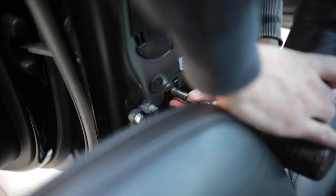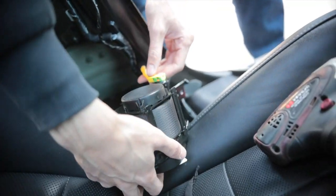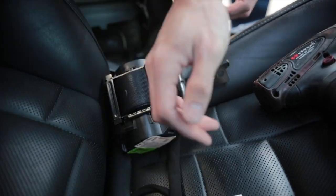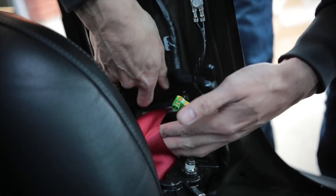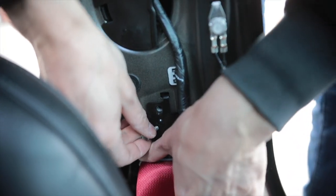This is a 10 mil. And then there's a connection for the airbag system — there are two orange clips on each side, and you just look this up. Looks like the right size. Fish this back in. It fits in a little groove and then there's one up here. 10 mil first.